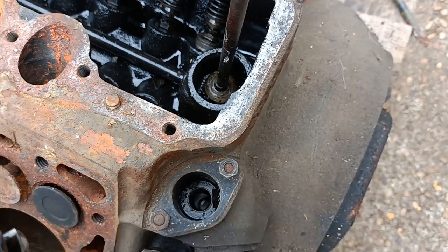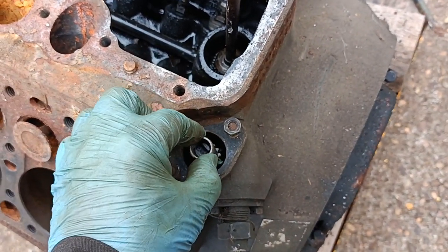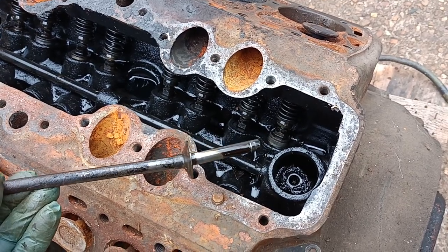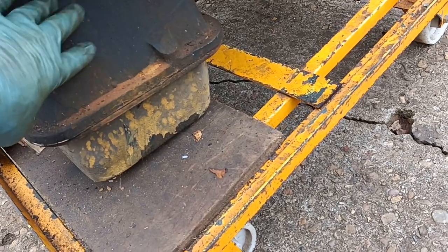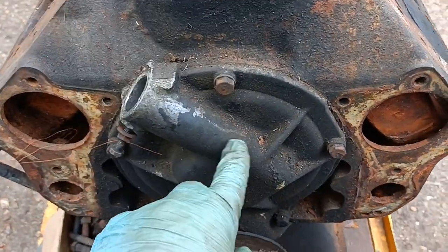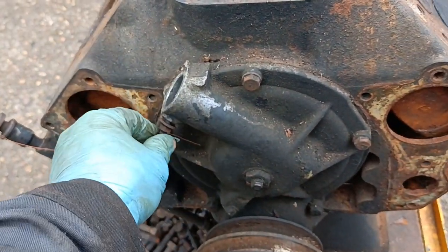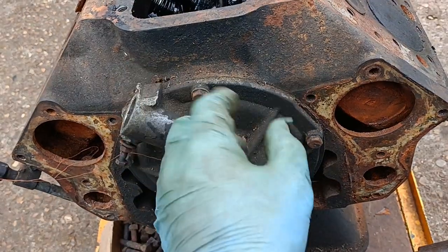Can you see right down there - there's not a D shape, it's a shaft with flats. There's the thing that goes on it - that's like an extension in effect. 59A type fuel pump fitting, look - bent. This has got the deeper sump pan, the deeper oil pan from the 4.2 litre engines. It's got an 8BA type thing there but it has a thrust button on the front and an adapter that takes the distributor in there. The gears are the same way as a 59A which puts the thrust back towards the block.